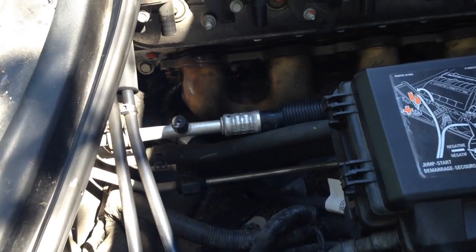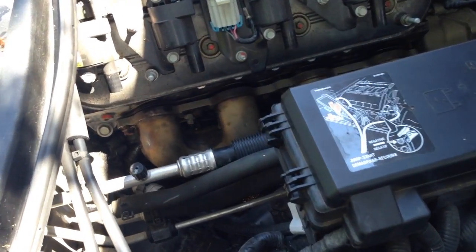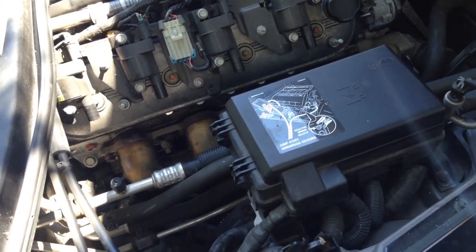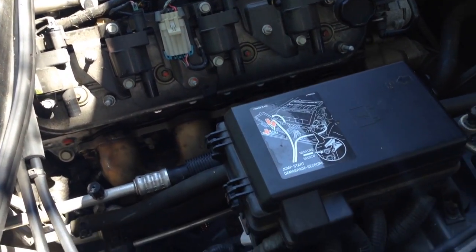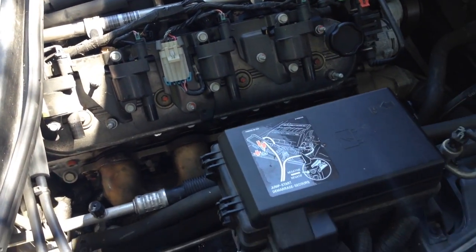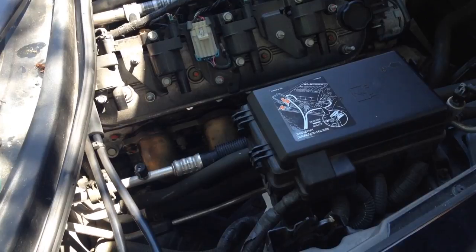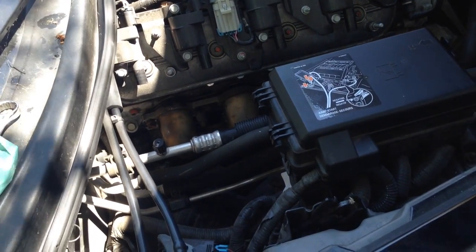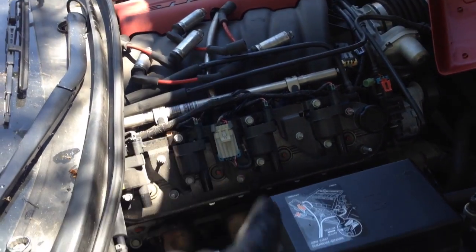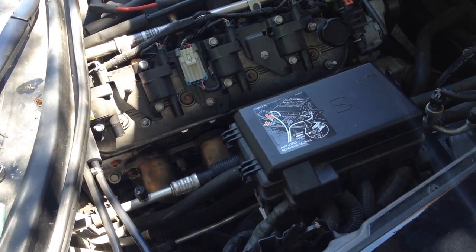That worked perfect. I've got all the manifold bolts started; I just need to go through and tighten them all up. I've got the manifold gasket on — make sure there is an up and a down, and a front and back on that. The gasket itself is marked: it's got the manifold side marked and it's got 'down' marked. So just make sure you get it on right. Then we'll bolt the manifold up, go back under once the manifold's bolted up, and finish snugging up those exhaust bolts. The starter is all bolted up, all the wires plugged in. Once the exhaust is back together, we can put the plug wires on — I'm going to put a little dielectric grease on the plug wires before I put them on. We've had our battery charging; it should be charged up now, and we'll see if this thing will start.